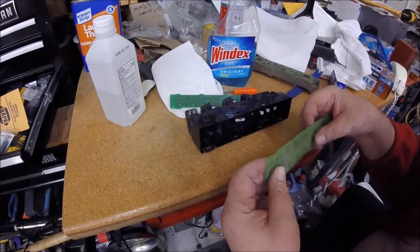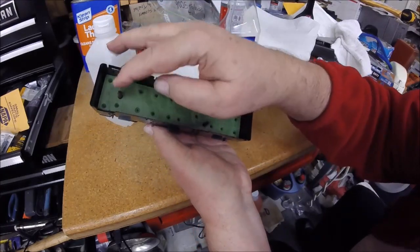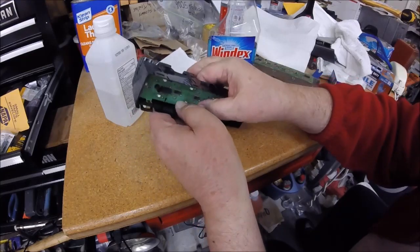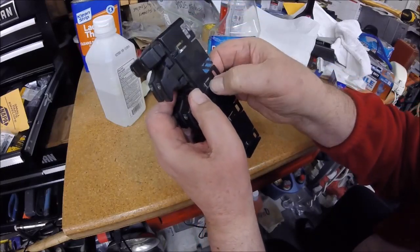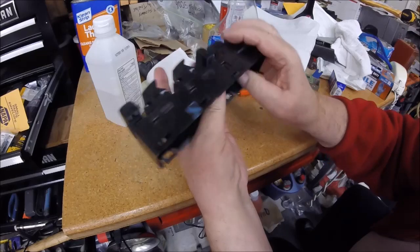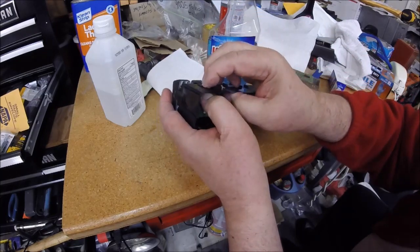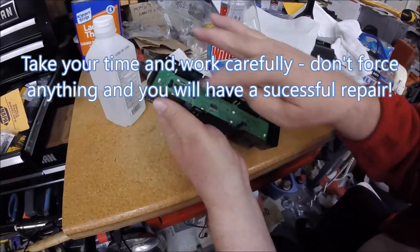Now let's get this thing back together. You can't really get it in backwards because you have these two pins - the contacts come down and hit the board and it only goes in one way. It slides and snaps. There's a tab under each one of these. Make sure each one is locked - there are eight of them. Hear that click - click, click, click. All eight are in, confirmed from both ends.